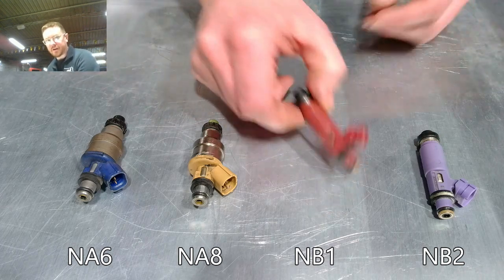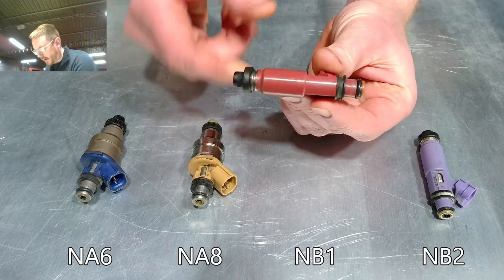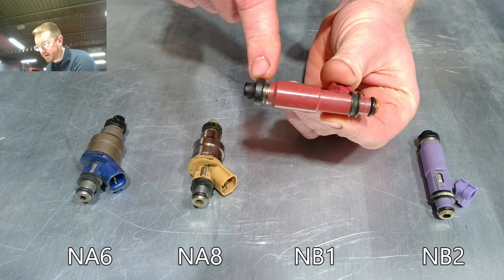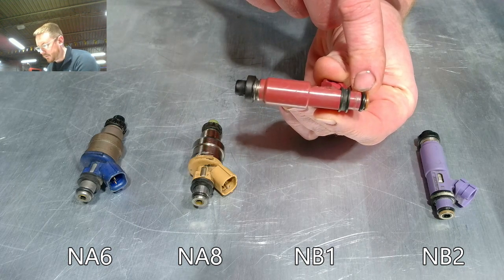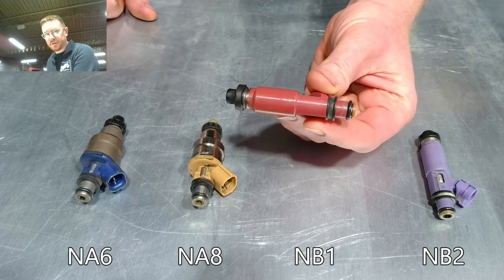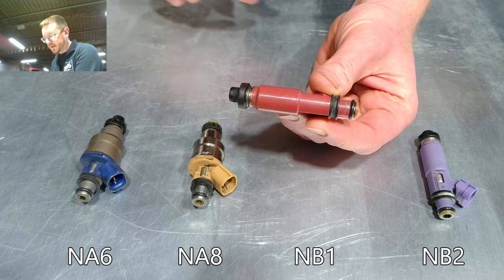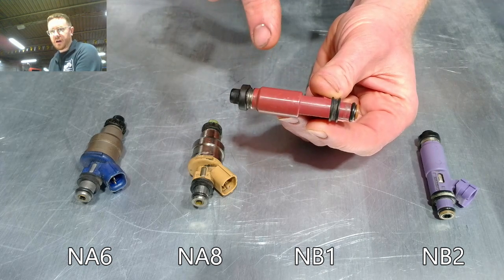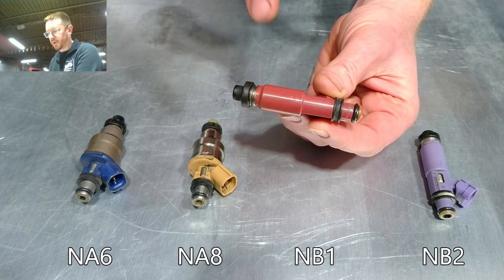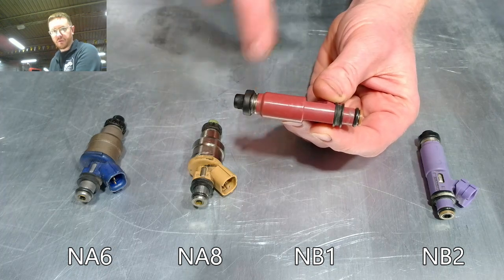There's not very much to this, but the key points are: it has this spacer at the top, it has this little seal at the bottom, and then it has this o-ring. Now all of these are wear items, and anytime you take the injectors in or out — especially if they've been in there a long time — any of those can get damaged. Luckily you can buy kits from pretty much any parts store that will have the full set, usually per injector, so you'd need four kits to give you four o-rings, four spacers, and four little seals.